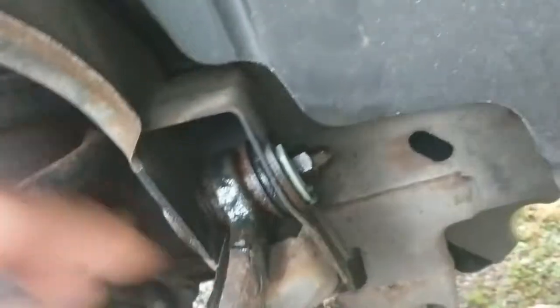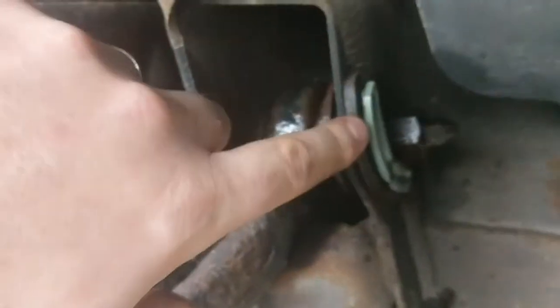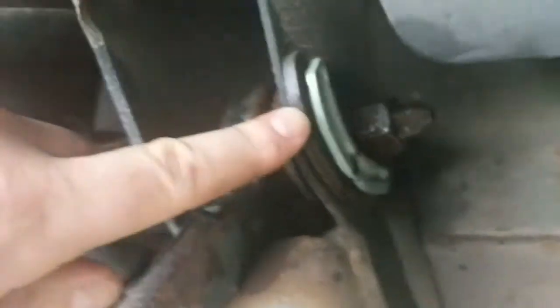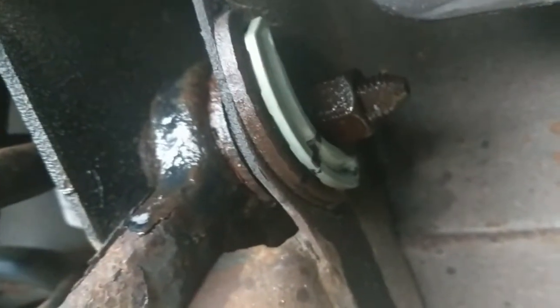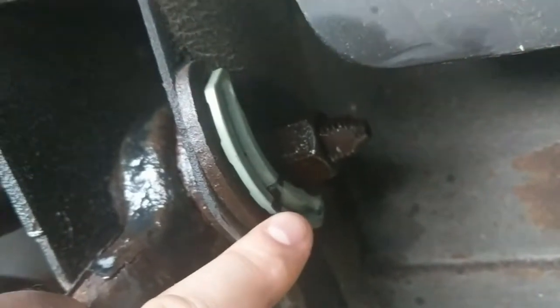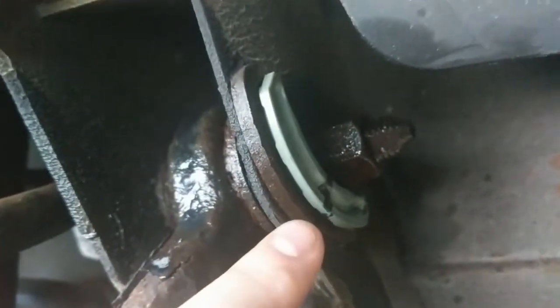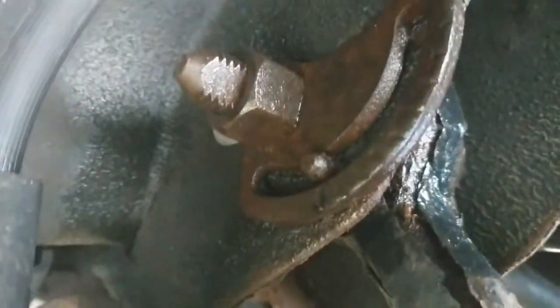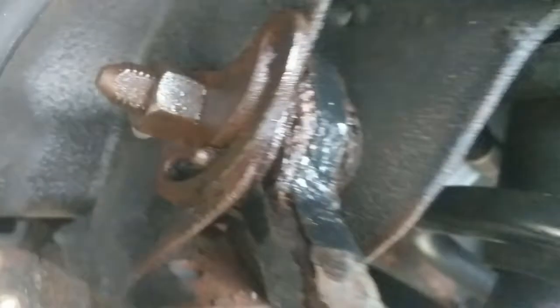Alright, wheel's off. We've got these — I can't remember, camber cam shims or something like that — anyway, these things right here are going to come off as soon as you remove the bolt. I've hosed all this stuff with WD-40; use whatever you have — PB Blaster or whatever, it'll all work. I marked the location — there's a little piece of steel that sticks off the frame member and goes through a slot. There are four of them and I marked them so I know where they line up and which side is the outside.